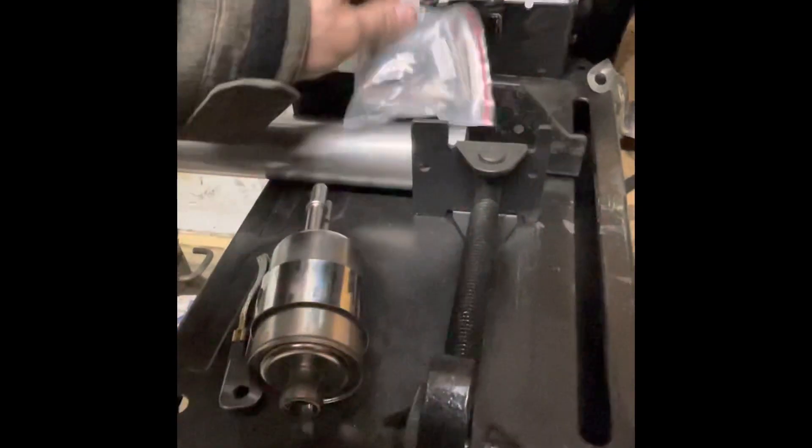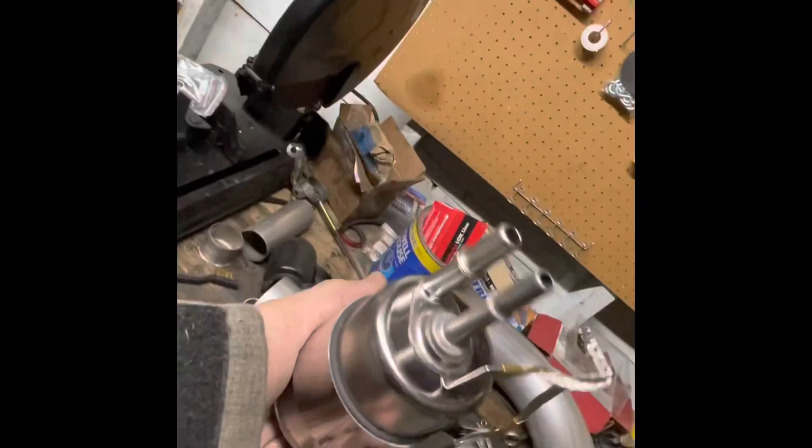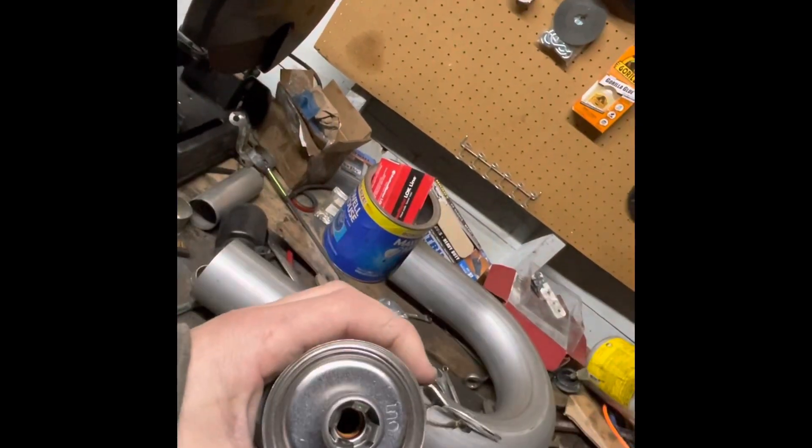Right here — that's my fuel regulator. It was like 40 or 50 bucks. It's a fuel pressure regulator and fuel filter combo — I think it's stock on C5 Corvettes or F-bodies or something. It has high-pressure and return lines, and then it goes to the returnless LS-style fuel rail.